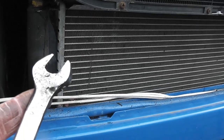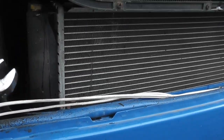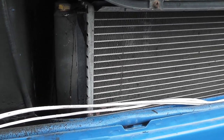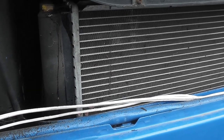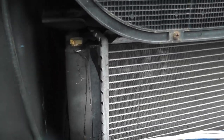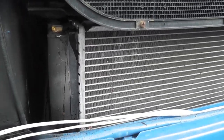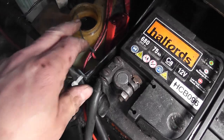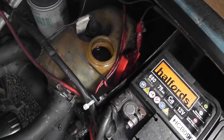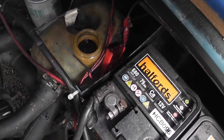The only thing is I never drained the radiator — I didn't take the bottom hose off the radiator. If I did, air would have come out of there and you basically leave the air coming out; you may need to pump up the foot pump a few times until you get bubbles and then a stream of coolant. So that's basically it, and I didn't even start the engine. The last thing to do is top up that coolant tank to the brim, then reinstall your filler tank that goes in behind the reg plate — you had to remove that to do this, or at least take the pipe off. Put the pipe back on and fill that as well, so it should be up to the max mark.